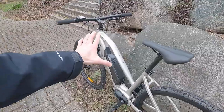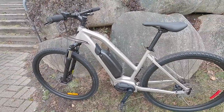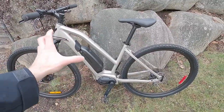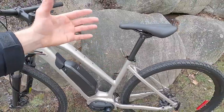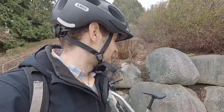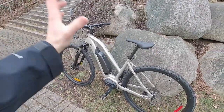It only comes in a mid-step frame, but the way they've set this up with the double tube, it's a very sturdy mid-step. It's not like some of those wave frames that end up being heavier because they have to use extra material to reinforce and get that stiffness. So you end up with lightweight but still fairly stiff, with a medium standover height versus super low or the traditional diamond with a very high standover height. I want to mention that these are only being sold in Canada right now. DaVinci seems like a pretty large and well-established, respected brand, but they are fairly Canadian-focused.